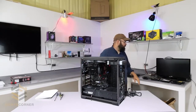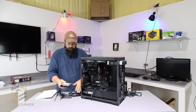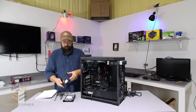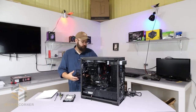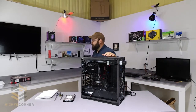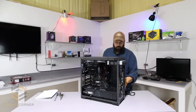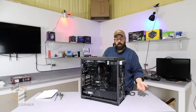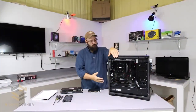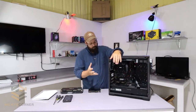There's one last step. This particular case comes with a hard drive caddy — there are two of them on the back. You just put your hard drive in the caddy; there are tabs on the side that open up and lock your hard drive right into place. Piece of cake — it goes in the back. Right behind here is where you put your hard drives and they just slide right in. When you first purchase the case, one of these caddies will have a little brown box in it with all your screws. The hard drive is in — all I have to do is connect the wires and it'll be operational.